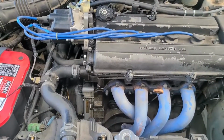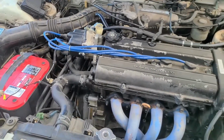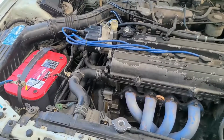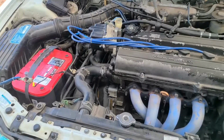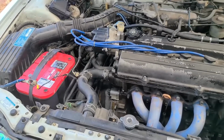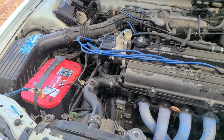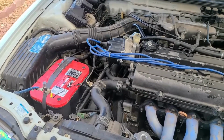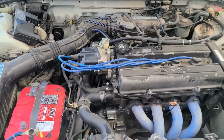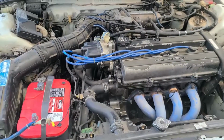The transmission, I believe, is the small spline. I thought it was the old B16 cable, but I'm starting to think it's just the Y1 LS transmission, which, for those of you that don't know, has a 4.4 final drive, which is probably why it feels like it has a little bit more pep than the Hydro B-series LS transmission. But regardless, everything runs and drives smoothly.